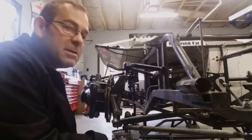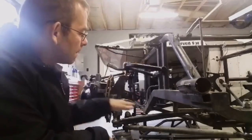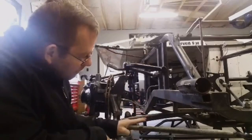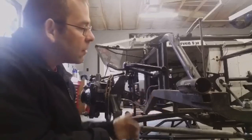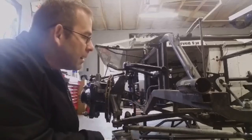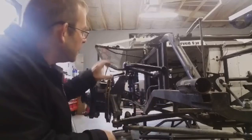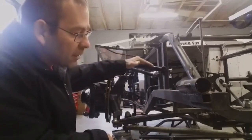Here we've got the upper control arm and the lower control arm. As you can see, we've got an angle in our upper control arm, and our lower control arm runs uphill to the center of the race car a little bit, which gives us a higher roll center. This car was built for an open motor with a little more horsepower, and it was run in a crate last year. So rather than changing the chassis points, what we did to change the roll center was go to a taller ball joint, which gave us greater upper control arm angle and lowered our roll center down.